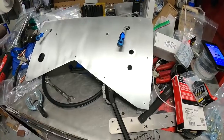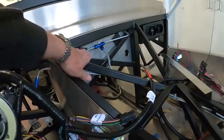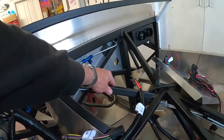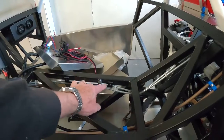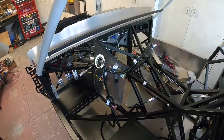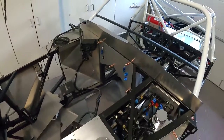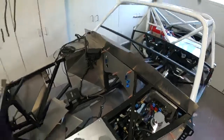All the plumbing on the fire suppression system is now done. I've got two nozzles here and here that will cover the headers, fuel system, and pretty much the whole engine. The tubes run down, teed up, clamped to the tube, and run back up. As I said the pull cable hookup will come later because I've got to get the dash in first. Thanks for watching - if you liked this video hit subscribe and we'll keep them coming.